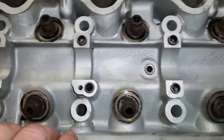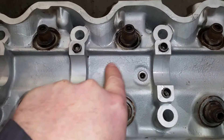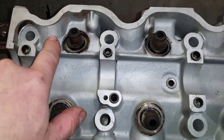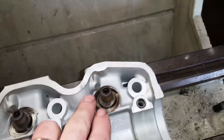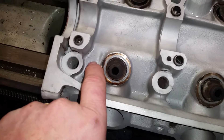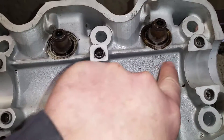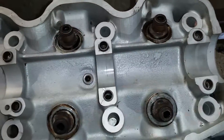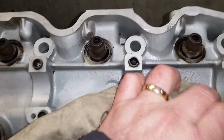No visible signs of cracking, but this casting is actually quite a bad casting when you look at it. There's a lot of areas where the metal hasn't flowed as well as it should have when it was molten. You can see daggy bits all over the place. A poor casting is usually going to crack whether you want it or not — over time they will, especially if they get hot: they soften up and then they'll just crack along where these imperfections were.